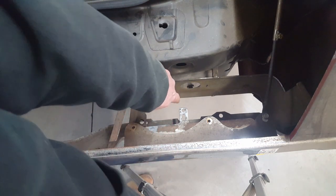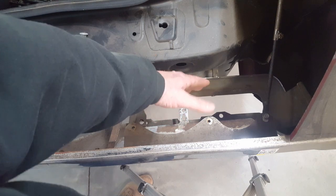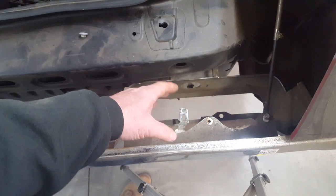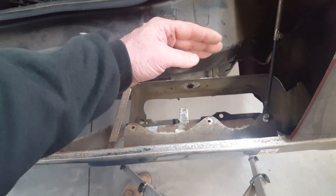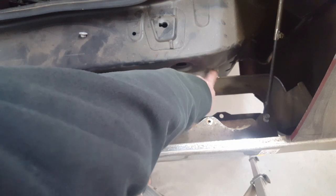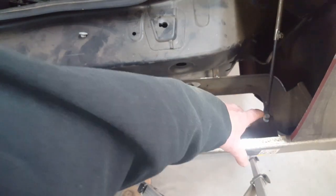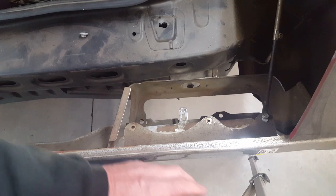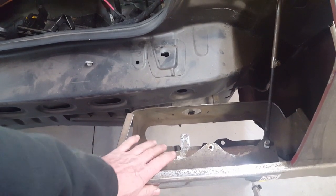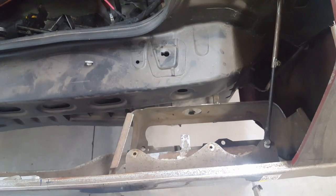There's 3 bolts right now that bolt a plate to the existing frame rail where the stock bumper on the Challenger went to. So it's just a flat plate sticking straight up, and then I have a couple of pieces of 1/2 by 1/2 steel welded to that plate, one there and then one on the bottom on a diagonal, just holding it to that plate. And then I have these temporary outriggers that just bolt up to the body, and they keep it from rotating up and down. It vibrates pretty good. If you leave this out, this is pretty shaky.